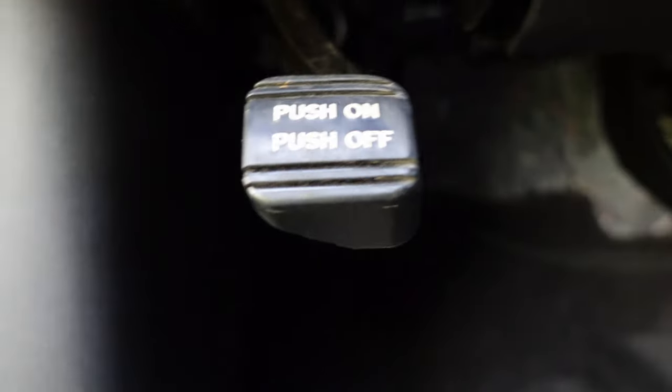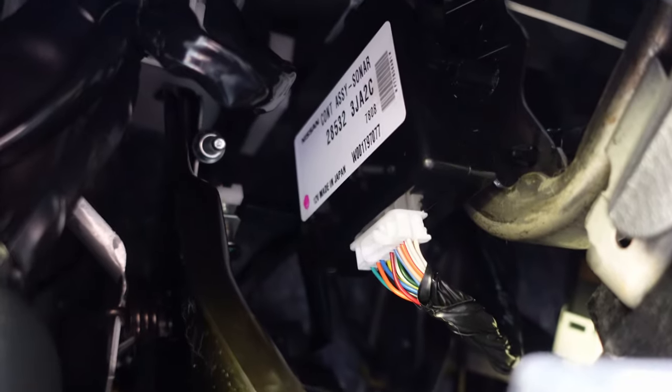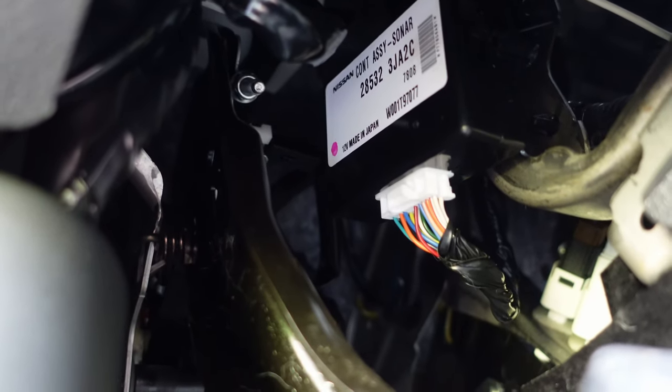This pedal has a cable connection right up here in the back — this is kind of difficult to show on camera, but I'm going to try. Following that up, we see a little adjuster right there, that little bolt. And that's what we're going to use to tighten the cable and provide tension to those rear brakes.